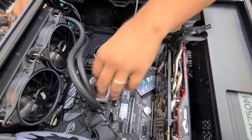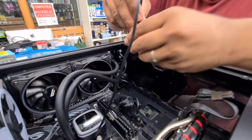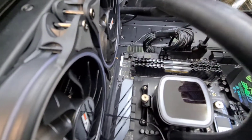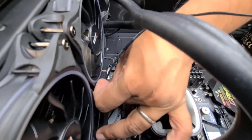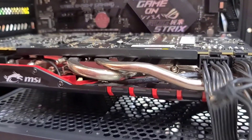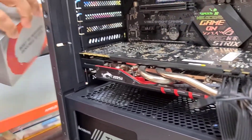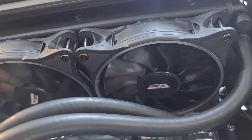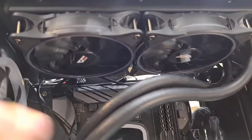Peel off the plastic tab, and this connector, as I mentioned, goes to the CPU fan header right here. There are three connectors on the plug but four pins on the header — don't be confused, just leave it like that. So that's how you set up your Tracer DT240 liquid cooling — it's super simple. Choose the bracket according to your motherboard socket. If it's an AMD AM4 socket, choose that one; otherwise, the Intel bracket is also included in the packaging. Thank you so much for watching — I hope to see you in the next video, bye for now.